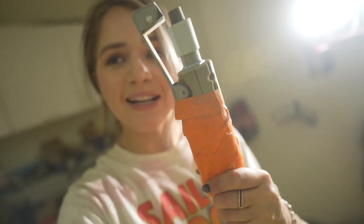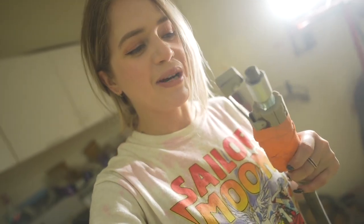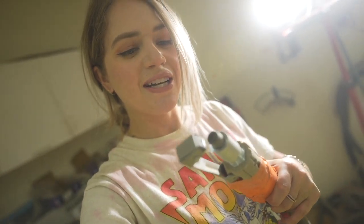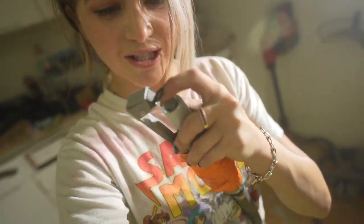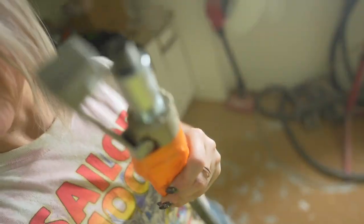So I ended up taping this wide open. And once it was on, I would just slowly feed the media in until it was just getting by. And it really wasn't working all the best, but I was able to somewhat control it. But I couldn't ever shut this off, because if it went a second with this closed, boom, it would get clogged again. So that was the first issue. I called around and they didn't have any bigger media tips anywhere, so I just had to make this work.